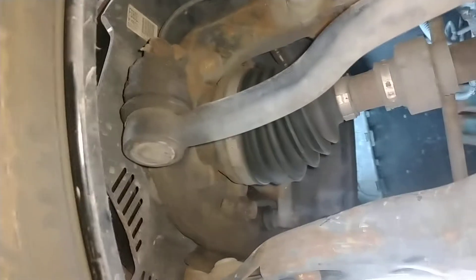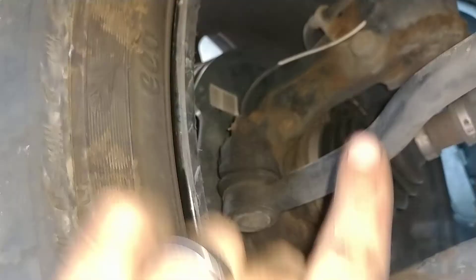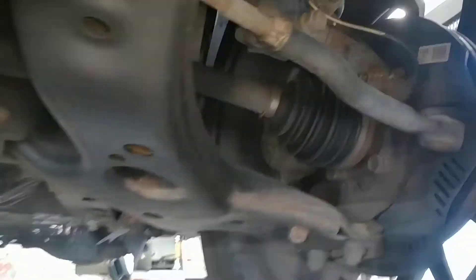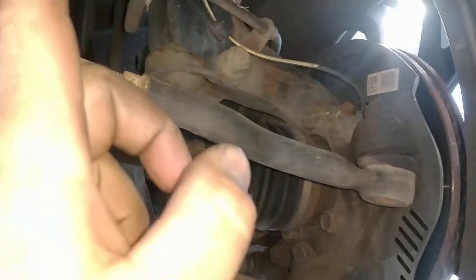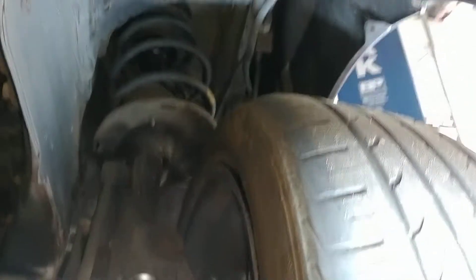It's got quite a few lights on. And that should have been the first question for the people who looked at it before me. He'd taken it to two different shops — one shop replaced this wheel speed sensor, the other shop replaced that wheel speed sensor on the other side, and both times it didn't fix it. So he took it to the dealer and they wanted $700-something dollars to replace the brake control module.